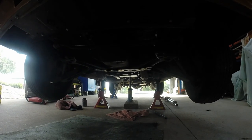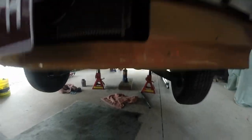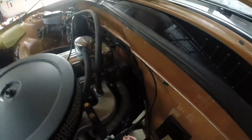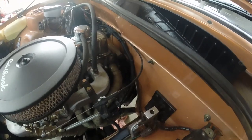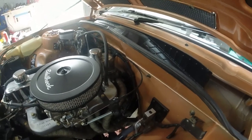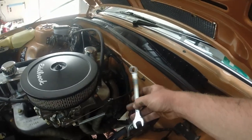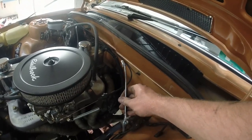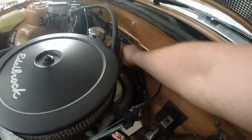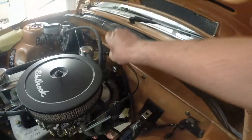The auto's now in, as you can see. I made sure as I put it in that there's still clearance between the converter and the flex plate. I just thought I'd show a little tip for getting at the top bolts back there — they're pretty close to the firewall and the trans tunnel, so you can't really get a spanner on them from underneath even with a uni, extension or socket. What I've done is just taken a cheap spanner, a bit of heat, and a slight extra bend in it, and you can just get down there easily to do those two top bolts up.